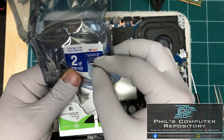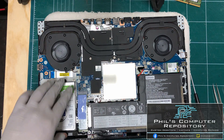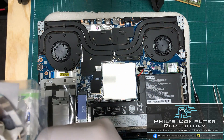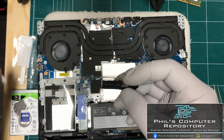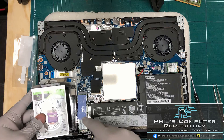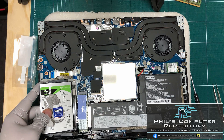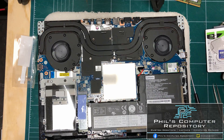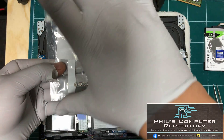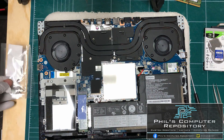I'm going to put the warranty sticker on the hard drive to register its two-year manufacturer's warranty. We have to take the tray out and screw the bracket into the hard drive first. The hard drive cable package also comes with screws. This cable plugs into the motherboard with this connector — if you've never worked on a laptop before, be very careful because the connector is very delicate. I've had customers rip connectors out of laptops because they weren't used to how fragile it was. The four screws that come with the hard drive cable package are used to connect the bracket to the hard drive.